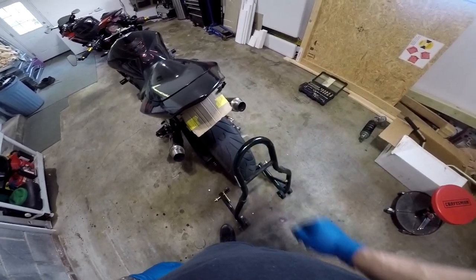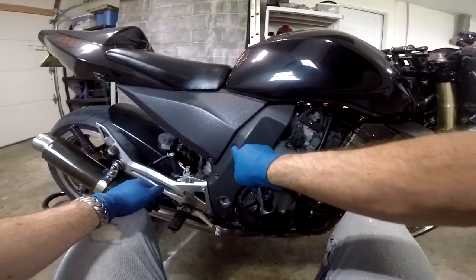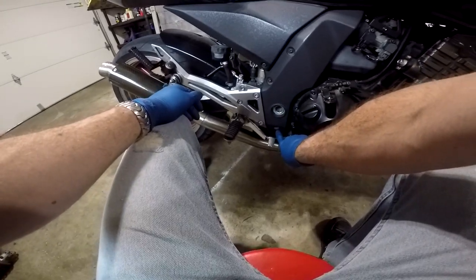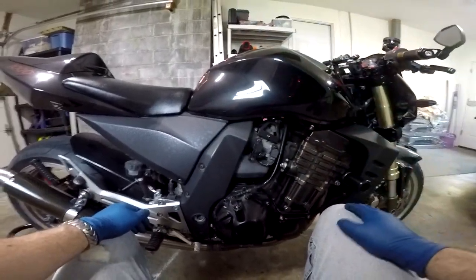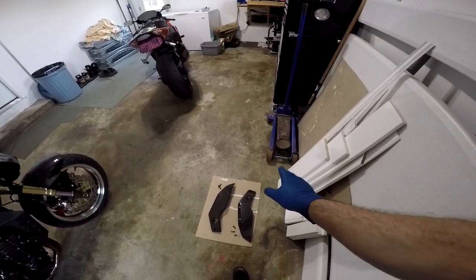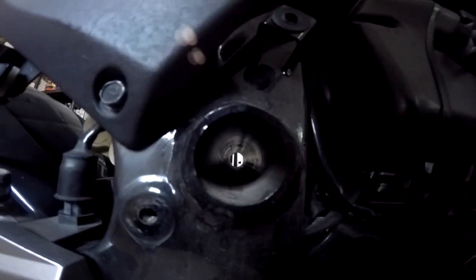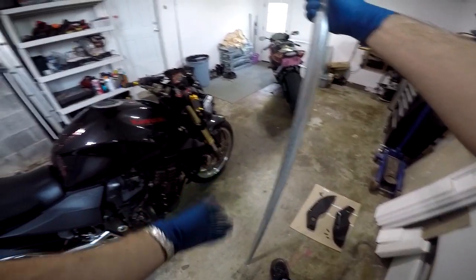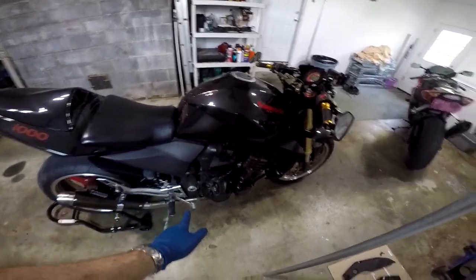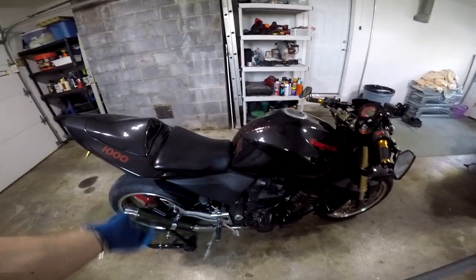For starters, go ahead and lift the bike up with your sport bike stand. Step two, you're going to want to remove the side covers — it's just three screws. Remove this one and the one on the other side. Now after you take both covers off, you'll notice there's a hole in your bike. Find yourself a piece of pipe or a rod — something strong and sturdy that can hold a couple hundred pounds — and slide it through there. We're going to use that to lift the back end of the bike up and take the weight off the swing arm.